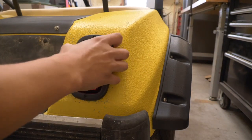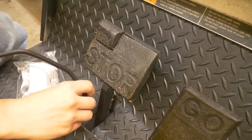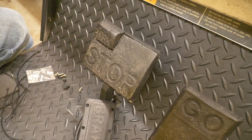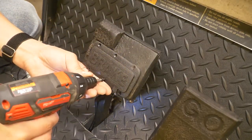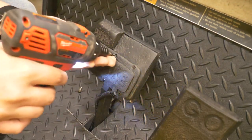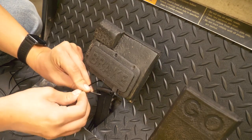We're going to wait a minute before screwing these in because it's going to be a lot easier to plug in the harnesses if we can reach our hands through here. Now let's go ahead and do this brake light switch. This pad here actually just screws right on top of the brake pedal. Drop that wire through the hole underneath. This comes with these really short screws which just screw into this rubber pad. I know this seems kind of weird but I've never had one of these fall off, so this should be all we have to do. Let's use the supplied zip ties to secure this cable.